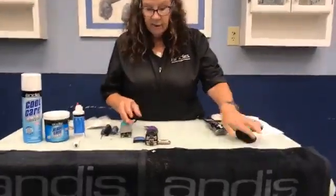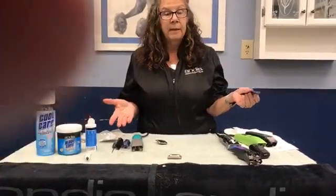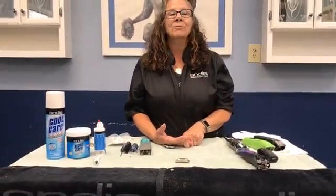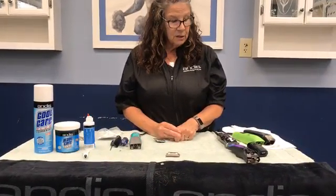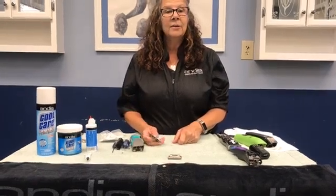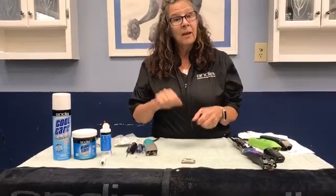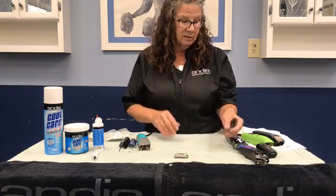And as I said, they will tell you when they need maintenance. They will be noisy. They won't cut properly, and you'll say to yourself, "What's wrong with my clipper?" It's time to change the blade drive. If for some reason you're clipping along and the blades are popping off, your hinge really needs changing. But every time you change your blade drive, just check your hinge, pop it down, check it with your thumb. You're going to need a flathead screwdriver though to pop it back up because they are snug.